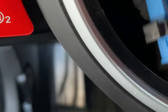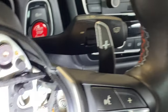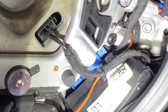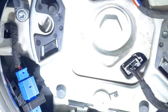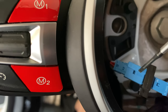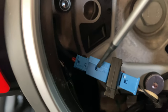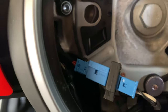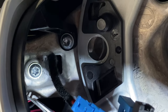Now we can undo the harness and remove the left shift lever. The right side might be more troublesome because there's a piece blocking it even more — we'd have to unclip that harness and take that piece out to gain access. But let's pull this left one out, get it on the bench, and have a closer look. You'll need something small and sharp to release this plug. The plug is a little loose and then you can pull it out. Now let's undo that screw on the left and we should be able to take the left shifter out.